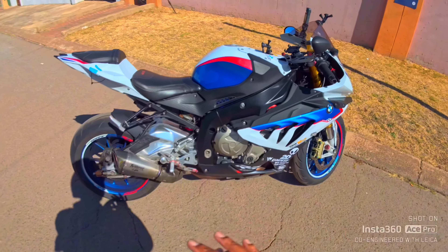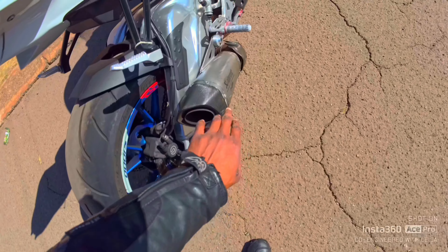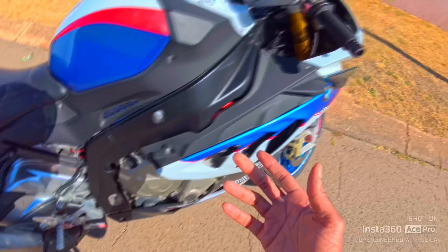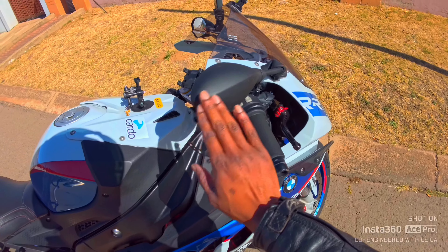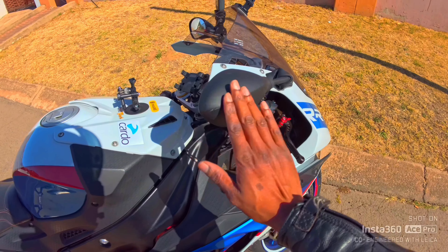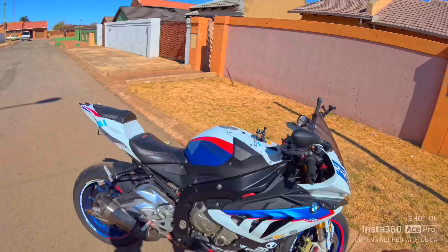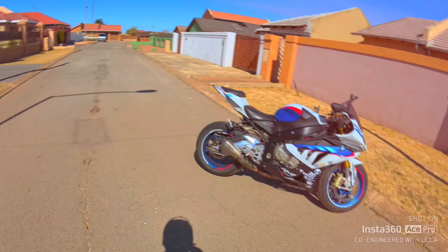The first thing you want to check — you obviously want to check for scuffing. If you look over here you can see the scuffing mark; you can see that this bike has fallen on the right-hand side. That's scuffing over there, that's scuffing over there, and also on the mirrors. If there's any scuffing, that just creates a bit of a concern. But if it's really graved in, almost like this part right there, that's gonna show that this bike has went down before. A bike that has went down doesn't mean it's completely crap, but it's a good indication to find out what's exactly going on.